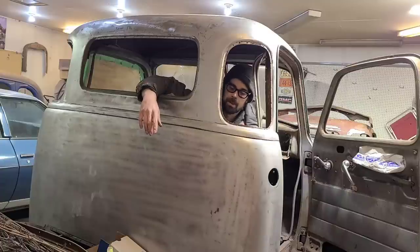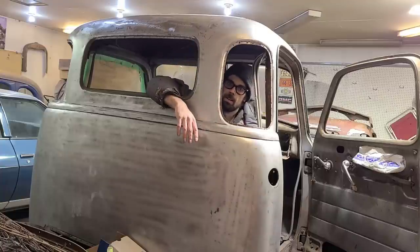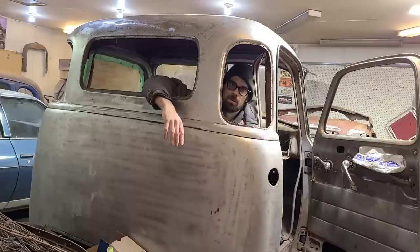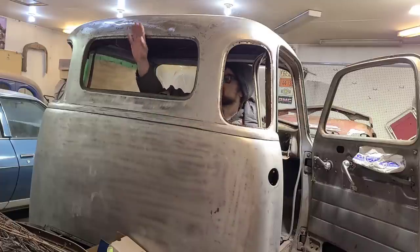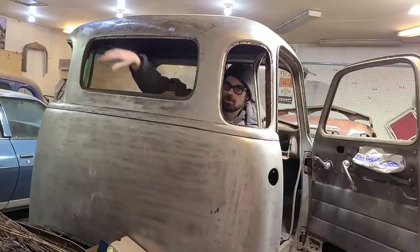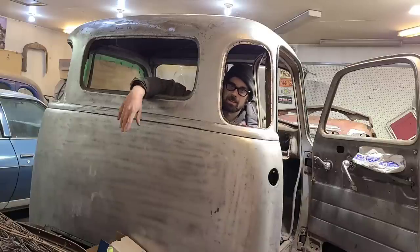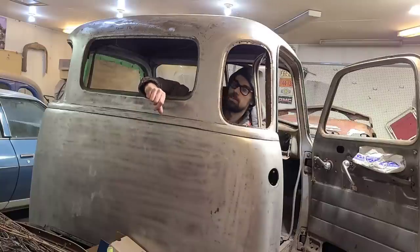Next video we'll be doing the inner structure, and I've got to fit all of the glass back in. These corner windows are tempered, so we don't have much wiggle room there. They either fit or they don't. The back window here is laminated, but again, we want that to fit, because you have to get custom glass made otherwise. It kind of hurts the next guy if the back window ever gets smashed out. So we want to make sure all the glass fits. That's the final test.